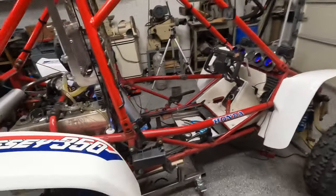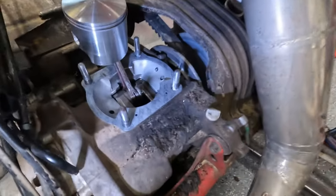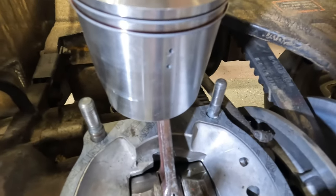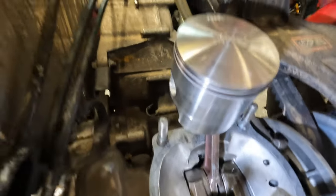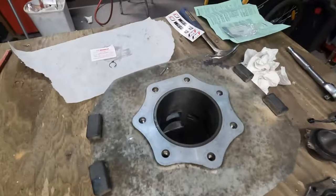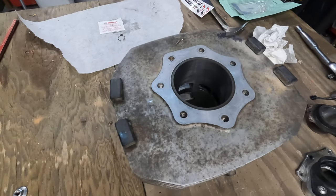Okay, folks, so this is kind of the end of this video, and we got quite a bit done today. We got the piston back into the machine. We have the exhaust port holes drilled on the piston. We followed the instructions for that, put the cylinder rings in it, and then we also put in the clip for the knuckle. So in the next video, we're going to go ahead and put the cylinder back on. It's all ready to go, nice and cleaned out. And then we're going to just start torquing things down. So we made pretty good progress today, and I'm pretty happy with that.